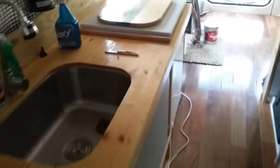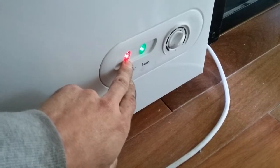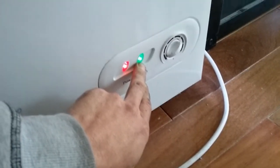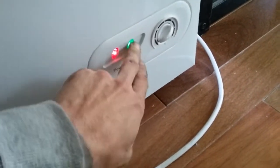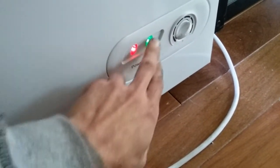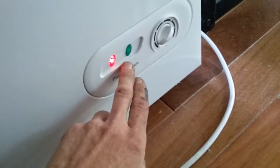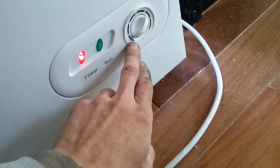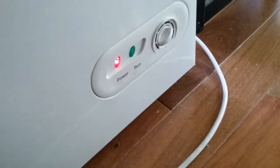I did the chest freezer today. It's running right now. When it's on setting, it has six settings — it has a power button that's always on when it's plugged in, and then the green button turns on when it's in cooling mode, when the compressor is running. Really good feature so you can always know if it's on and when it's running. It has six settings on the knob. Right now it's on setting one and it runs for like five minutes and then shuts off for like two hours.